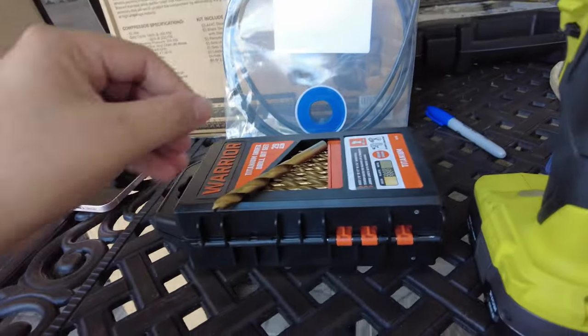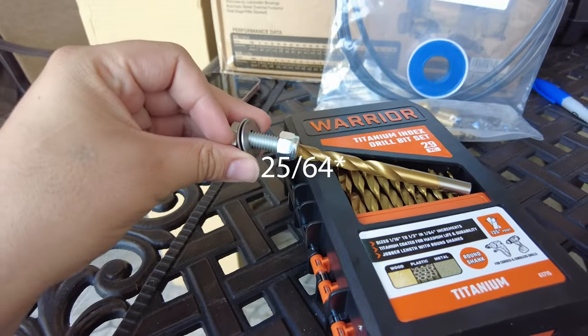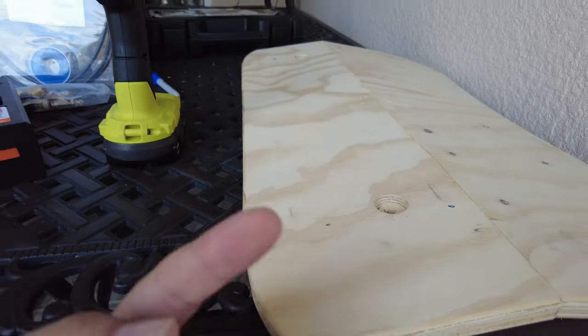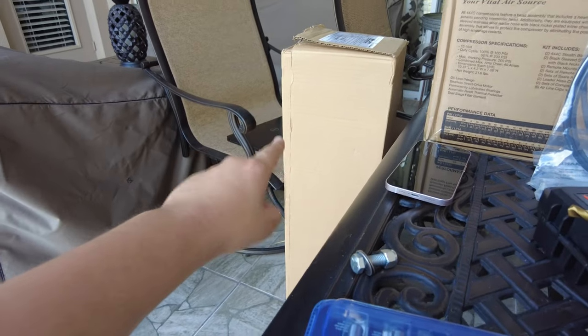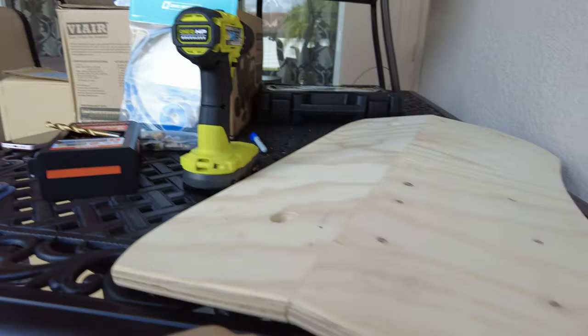So I went ahead and opened up the drill bits here. We're using an 11/32, that's what matches this bolt size. So that's what I'm gonna use to drill the four holes that are in blue there. I still plan to countersink it from underneath, that way the tank holds onto this part. The compressors I have right here, and honestly, I can't wait to show you how this looks because it's powder coated. It looks great. But I have the compressors here to mount to this.